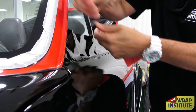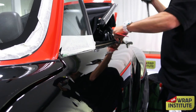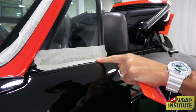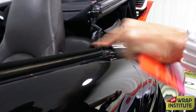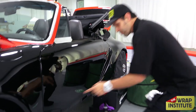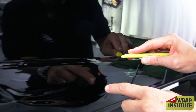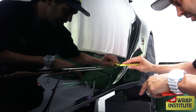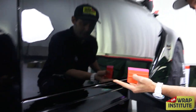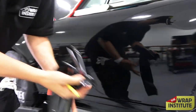Pulling it all the way across here right to the edge, cut it away. Notice all my material is going straight into the trash — your workspace reflects your wrap. If you have a clean workspace, your wrap is going to look nice and tight. Now for the bottom: I'm going to cut it flush straight — what I call an empty cut. There's no need to wrap around the bottom here because the client's never going to see it, so I save a little time by cutting straight to the edge and cutting the excess film away.